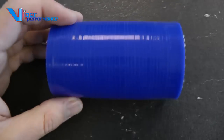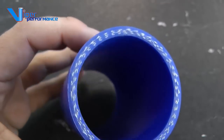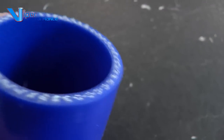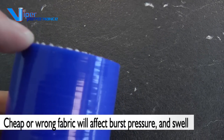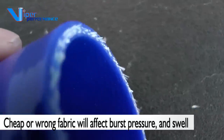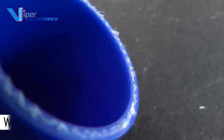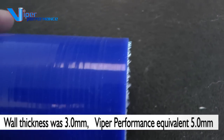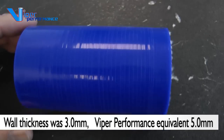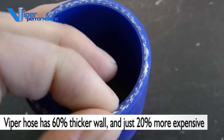Here we found a hose which is very very glossy, very pretty to look at, and seems to be nice quality silicone. However, this is let down by an extremely cheap quality fabric. We've actually dissected some of these hoses and you can see the fabric frays here very very easily. The fabric is very important in the build of a hose because this is what gives you the strength in the burst pressure rating. The hose looks good, might be slightly cheaper — perhaps 15 or 20% than a Viper performance hose — but on the pressure, on the race application, nobody knows the true effect of this fabric that just literally pulls and frays.